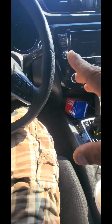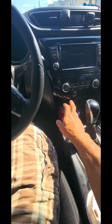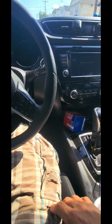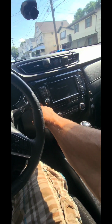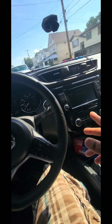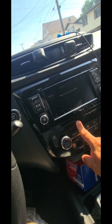I've seen a few videos where they're not detailed about what they did and what's going on. So to my understanding, it's not the blower that's the issue, or a relay, or a fuse. It's a blower motor resistor. And apparently the way that works is that you have to replace it. It's down there under the gas pedal. After this is replaced, you should be able to turn your car on, right? Just the accessory, and the blower shouldn't be running. Excuse the F word. Shouldn't be running.